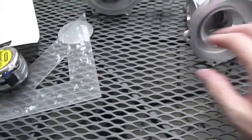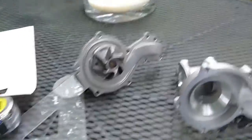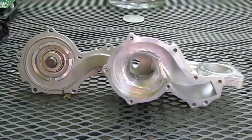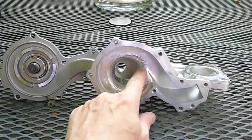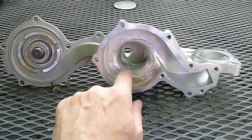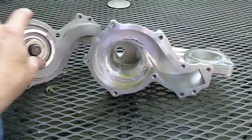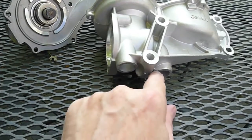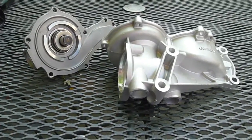Just cleaning up the hosing here. And then this will just become an idler pulley for the serpentine system that drives the alternator. So I've done all the trimming — I've removed the impeller, cut it away. On this side I've removed the turbine vortex assembly so that it's just smooth. The water comes in and then it'll flow through here nicely. I've cut off these auxiliary water returns and I'm going to thread them, tap them, and plug them. And then I'll have the inlet for the electrical water pump done. So that's looking good.